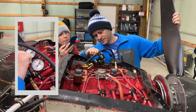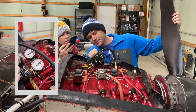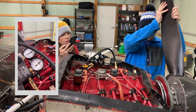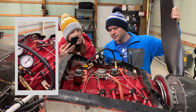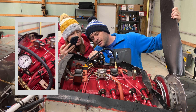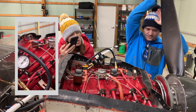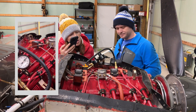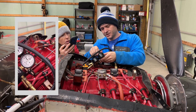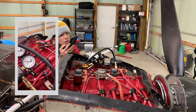Put 80 pounds on the left side, and we want to see what we got on the right side. What do you see over there? 76? 75-ish. Yeah, 76. Okay, that's what we're looking for. Is that the number you want? Yep. As close to 80 as you can get. 80 means there's no leakage whatsoever. 76 is fine. So let's write that before we forget it.